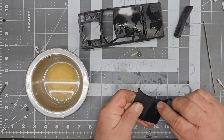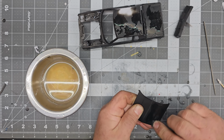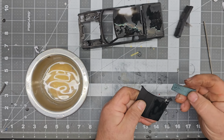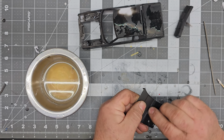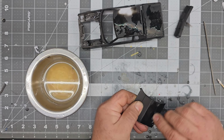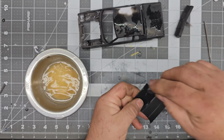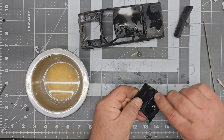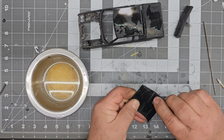Like I say, guys, remember, if you have a spot in it here and you paint it, that spot's obviously going to keep going up and up and up. And then in the end, you're going to try to sand it out of there. You're like, man, I can't get the spot out here. And then you're going to work on it, and you're going to end up burning through it because it wasn't in the last layer, it was in the first layer. So you got to get those out of the first layer before you go to the next one, because you're just going to bring it forward each time. So you got to really pay attention to where everything's at.